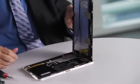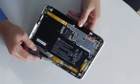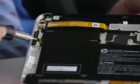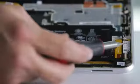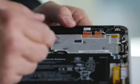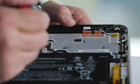With the removal of the display glass, you have access to all of the components on the inside of the chassis, just as you would with a notebook. Inside the unit you have the dock connector and the cabling system, the speaker system, the SD and SIM card connector, the webcam, the NFC, the battery, the wireless LAN, the antennas, the power board, and the motherboard — which is replaceable and contains the SSD, the processor, and the memory card itself.